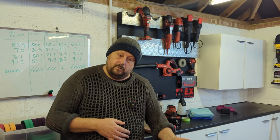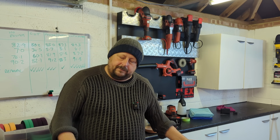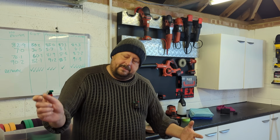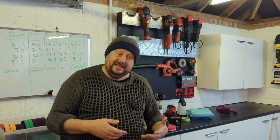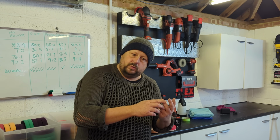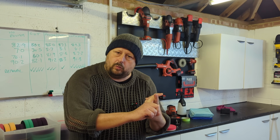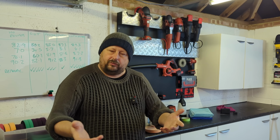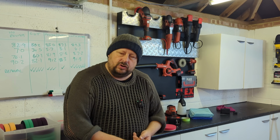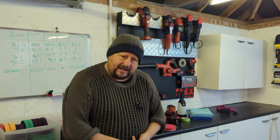If you spray your paintwork with fallout remover and it lights up purple after you've washed it, then you've got a lot of embedded fallout in the paint. By making it light up purple, you're shrinking it and then making the claying process perhaps easier, and you will hopefully pull more clay off. So there's some examples of chemical decontamination and physical decontamination. If you don't do step 1, the wash, properly, step 2 and step 3, the polishing's not going to be good. If you don't do the decontamination step properly and you go straight into polishing, you're going to be polishing into that contamination.